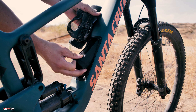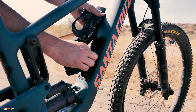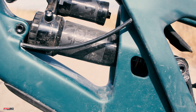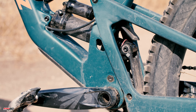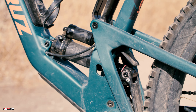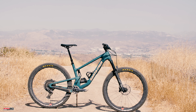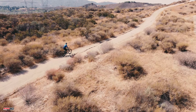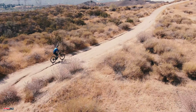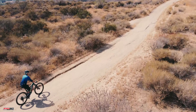Like with the Megatower, Santa Cruz has added a storage compartment in the down tube of the frame where the bottle cage attaches — they're calling it the glove box — and included two small bags inside to house tools, food, tubes, jackets, or whatever you may need on a ride. Another useful addition is the sag window carved into the lower seat tube, making it easier to set sag on an otherwise unreachable shock. It's positioned perfectly so you can both see the stanchion and move the sag indicator. Now that we know about the bike, let's go ride it and see if it actually works.